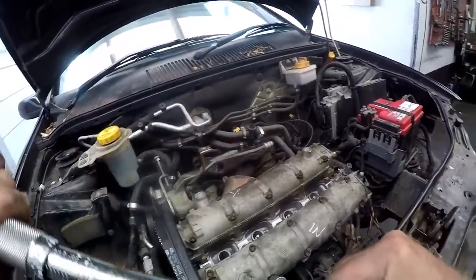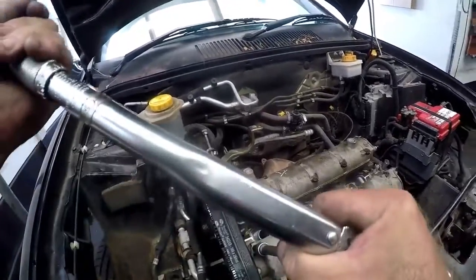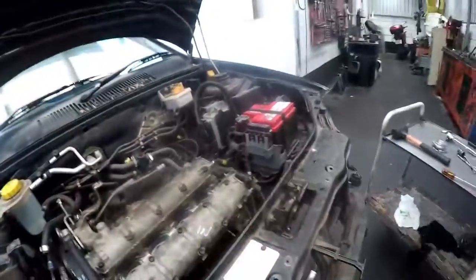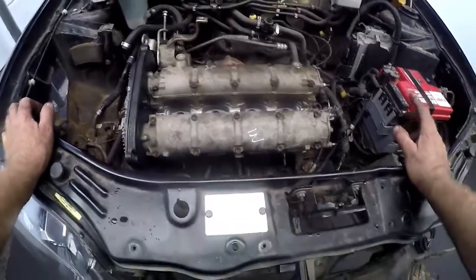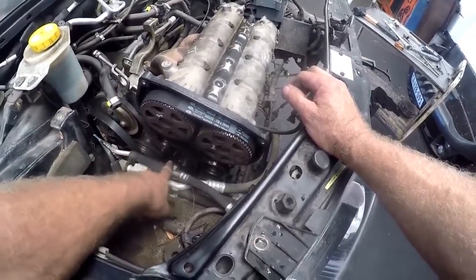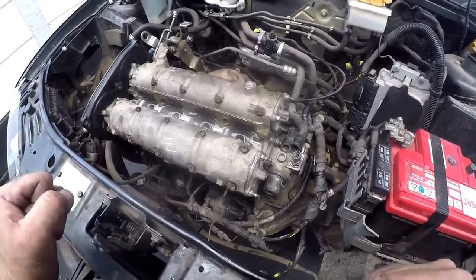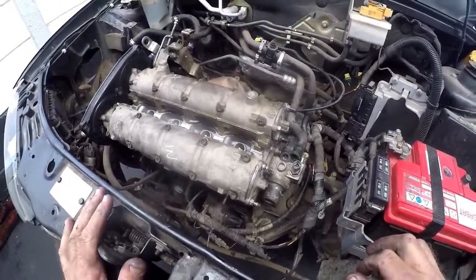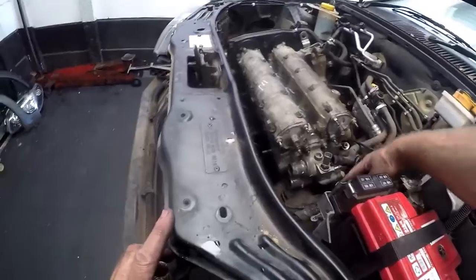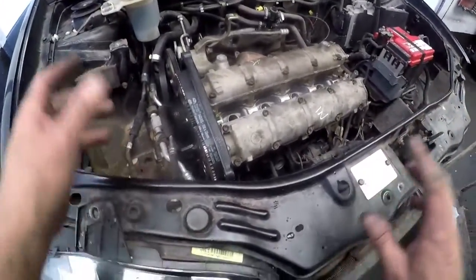So far we've tensioned up the belt — it's pretty tight. We didn't set the tensioner to its mark yet, but we've taken out the blanking plugs so we can now turn the motor. Make sure that any devices you've put into the bottom end of the engine to hold the crank in position are taken out of the way. Also ensure your timing marks are lining up before you start turning the motor — the top dead centers and all that kind of thing. So now we're going to turn this engine 360 degrees twice and then bring the top dead center mark back to where it was, then check that all our marks are lining up again.